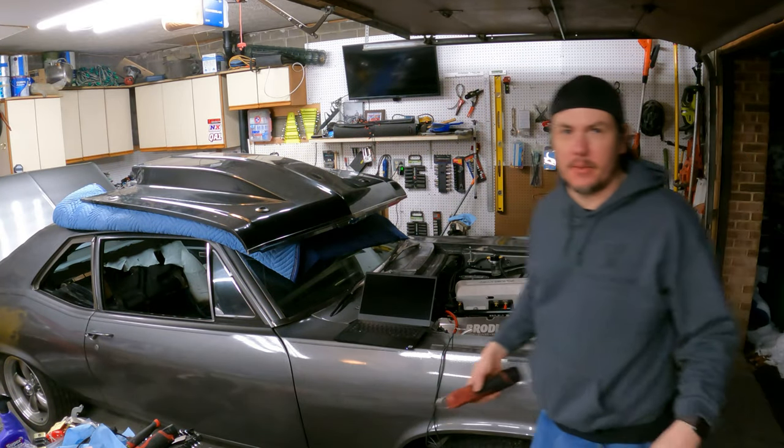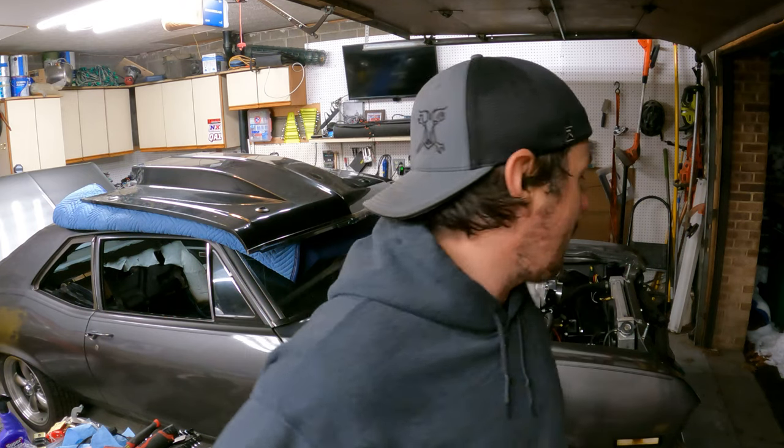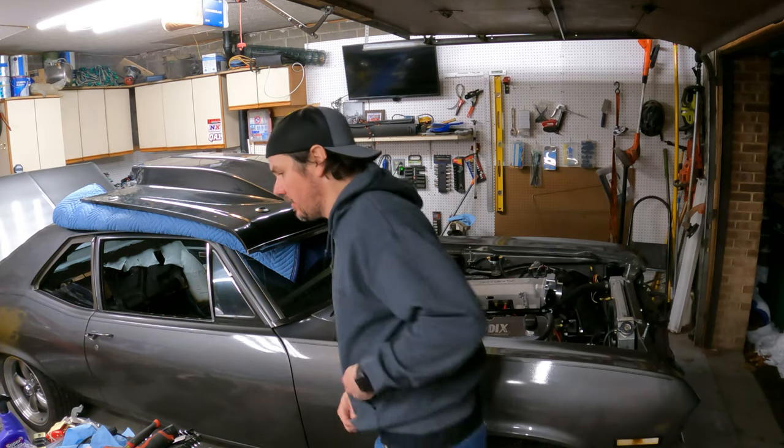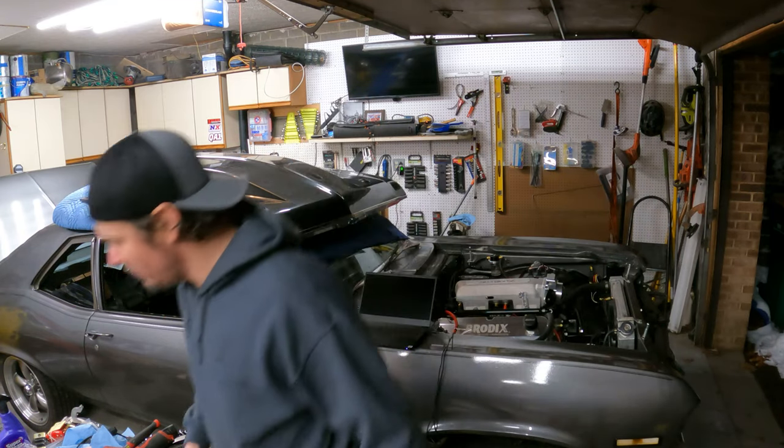The camera died, but the thing fired up — big huge vacuum leak. It helps to have all the plugs in your intake manifold. Oops. I killed power real quick because the alternator belt was smoking really bad — it was literally melted to the alternator. So I'm going to have to do a pulley alignment check. I've gone ahead and taken that belt off. We're going to crank it with a battery charger on and see if we can get it to fire up.